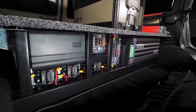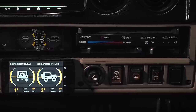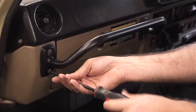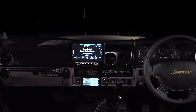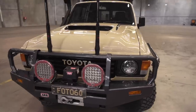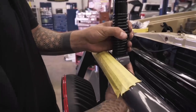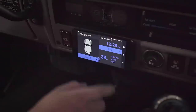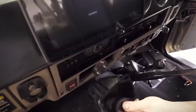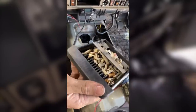The electrical in this vehicle is next level with all the Redarc gear. We've upgraded the dash by adding bits that provide extra functionality but still display the old-school charm. The Alpine Halo 9 is a perfect fit and has so many features. For comms we're running dual GME aerials up front — one is a UHF to talk to the crew and the other is cellular boosted to help people communicate on their phones. The addition of Links provides controls for heaps of switches and gauges in a small smartphone-looking device mounted where the old ashtray was — well, we don't need that anymore.